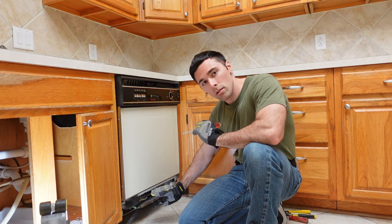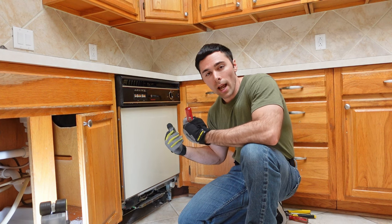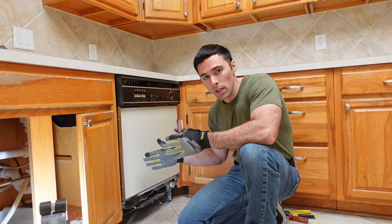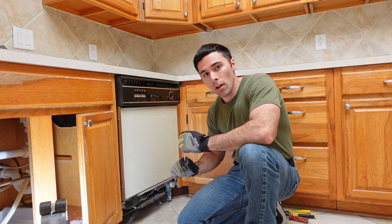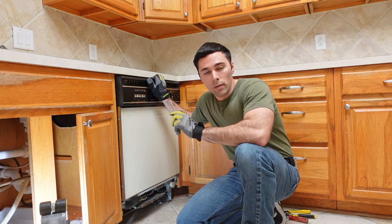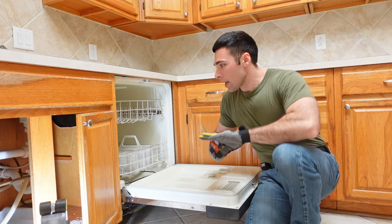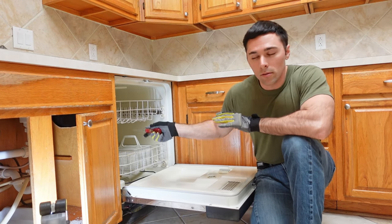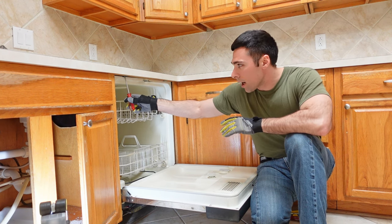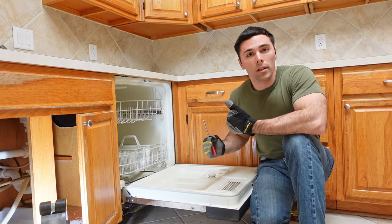I don't need to touch any of the electrical wiring underneath here, but I do need to pull the dishwasher out. Once I have it out far enough to access the cord, I can unplug it and then I should be completely free from anything it's attached to. To continue, I need to unscrew the dishwasher from the actual cabinet. I'm going to open the dishwasher door — typically your dishwasher will be screwed into the sides of the cabinets or the top. In this case it's the top, so I'm going to undo these screws, get it free from the brackets, and then pull out the dishwasher.